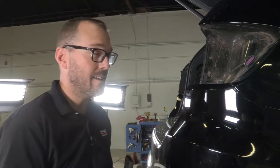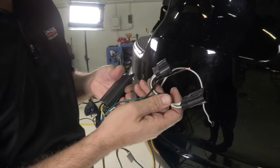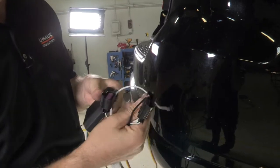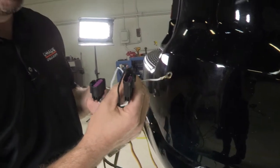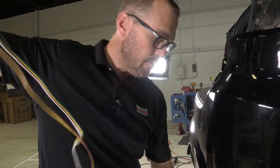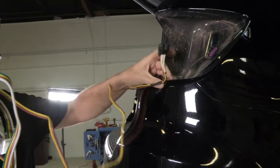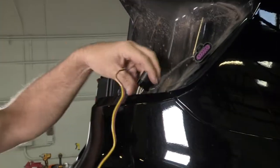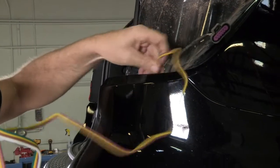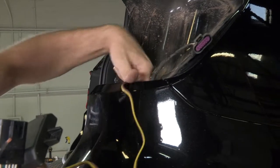I'm beginning on the passenger side tail light because I'm going to keep this green and white pairing of connectors, my power — which is this black wire — as well as my white eyelet, which will be our ground here. The rest of everything else I'm going to pass down behind the fascia where this factory harness is coming up. I'll show you in just a moment where the rest of this will go once it's behind here.